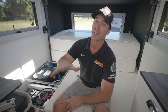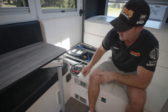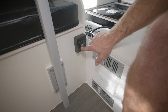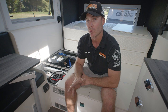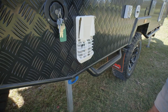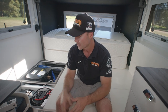When we use it on gas, we need to turn the gas bottle on and remove the cowl cover outside. Then we have our little switch for the Truma ultra rapid — we've got 70 degrees down, in the middle is off where we are at the moment, and 60 degrees is up. So we simply need to flick down or up and we will hear the system trying to light. The first time when lighting, we may get a little fault light — a red light — generally telling us the gas hasn't hit in time. So what we need to do is turn it back off, wait, reset, and hear it click trying to light. Now if you get three faults in a row, it's time to start troubleshooting. We need to check we haven't forgotten one of the steps — that we've turned the gas bottle on and there is plenty of gas in the bottle. Second, we must check that the cowl cover has been removed. If it hasn't been removed and gas has built up in there, for safety it's not going to light and we need to leave it to vent out. There's no point sitting here flicking the switch each time — it's not going to make it any better, so we might as well go do something else like pull out the kitchen while we wait for the gas to vent.